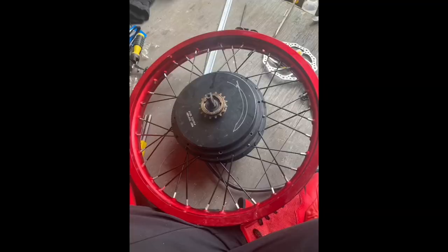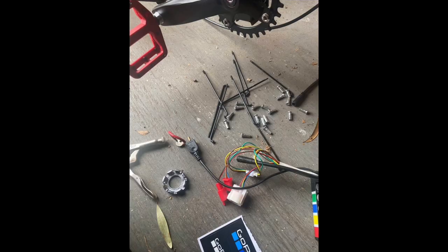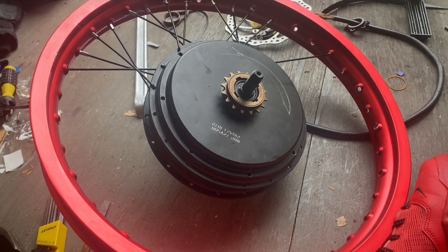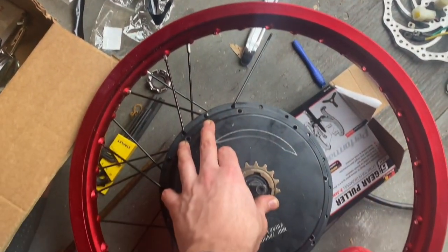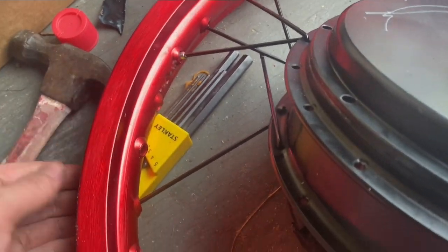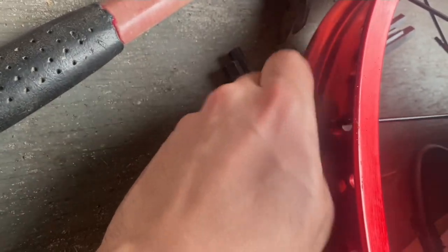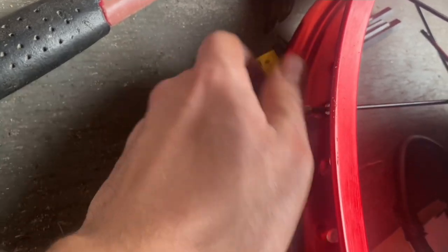It's a simple process — you got these screws and the spokes, you just want to loosen them up and pull them out. I recommend you try to level it on a flat surface because these spokes will bend easily and you don't want to put stress on them. You also want to remember the pattern. If you look at the holes on the rim they'll give you a good idea of where each spoke goes. You can screw the last ones off by hand or use an allen wrench inside the bolt.